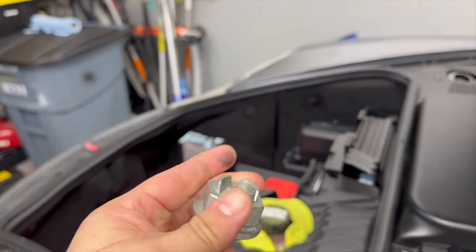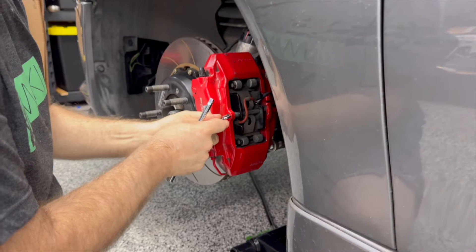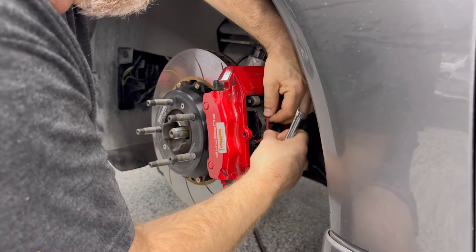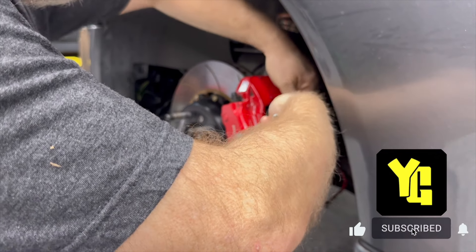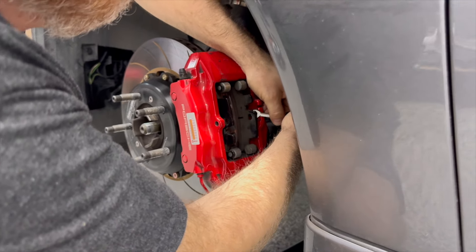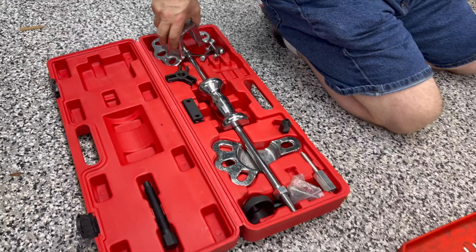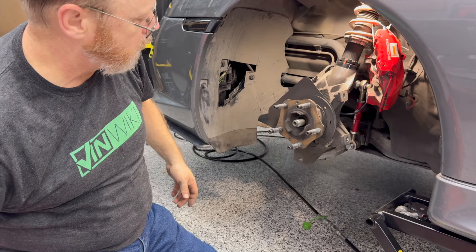You've got to hammer these in on the side. It's almost like a castle nut. And obviously we've got to get the caliper off next. Of course, it makes it really easy to get your brake pads off when you're in the pit stop and you've got to swap out your brakes for whatever reason. That little sticker on the front of your caliper — is that to gauge how hot your rotor is? Right, it tells you how hot your brakes are getting. I don't think I have a slide hammer. So this is what you need to get the hub off first.